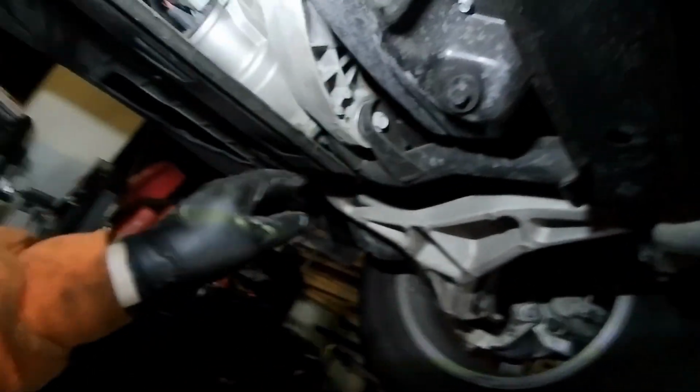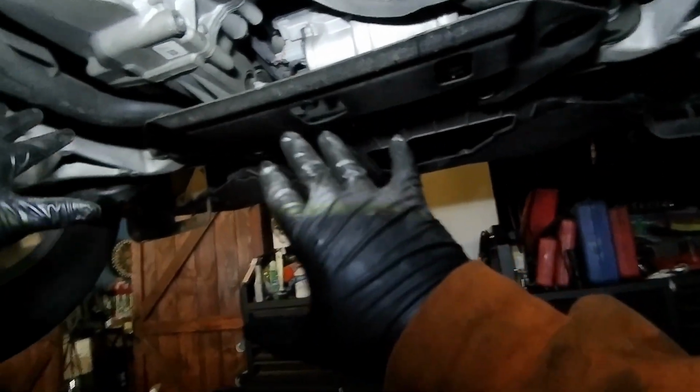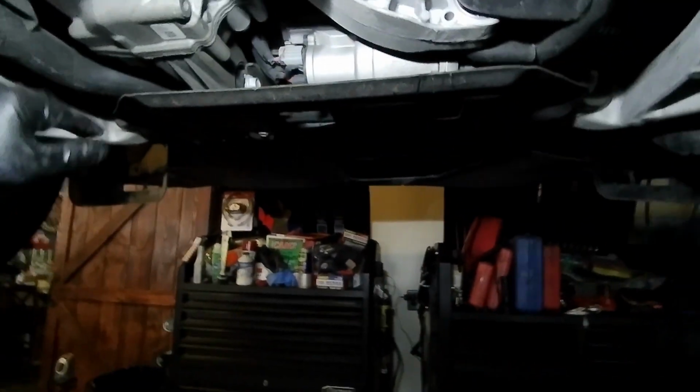And this is your oil pan that's underneath. It's always good to see that the oil pan is higher than the full body of your vehicle. So just in case you had a rock or road debris, the oil pan and the transmission are going to be protected because they are underneath the main supports of the vehicle. So that's always a good thing to see. But let's get this oil draining, and I believe that was a 13 millimeter that's on here.